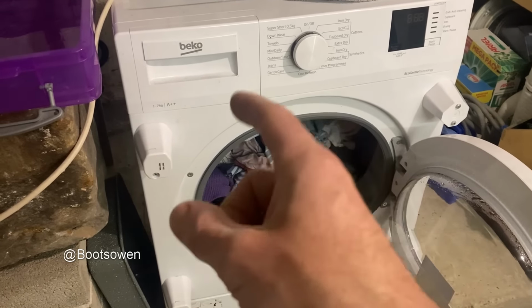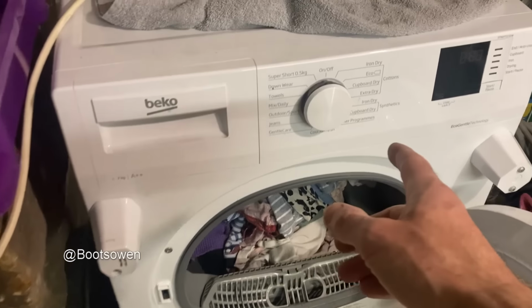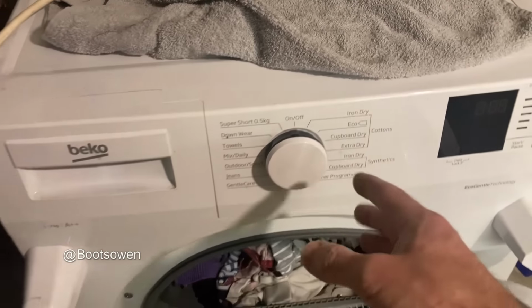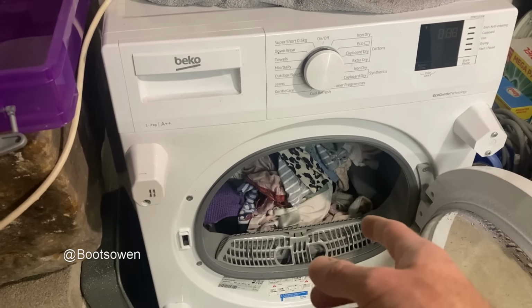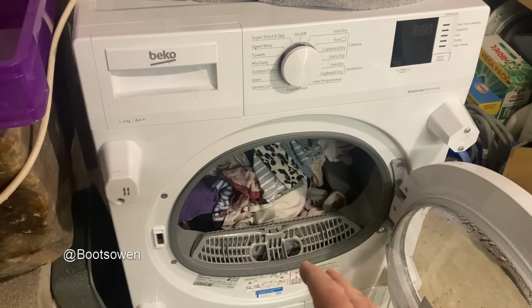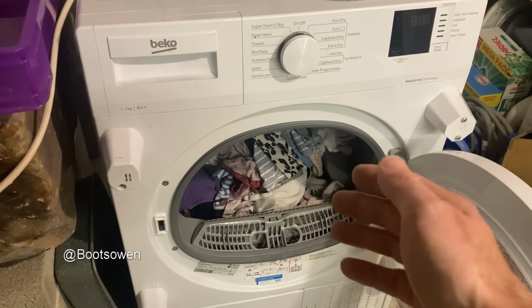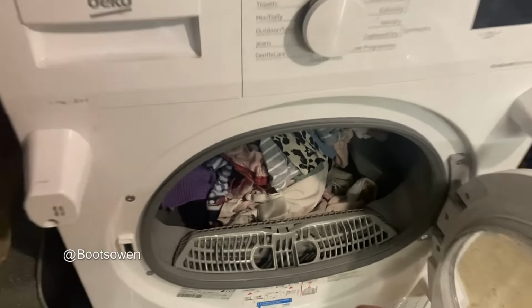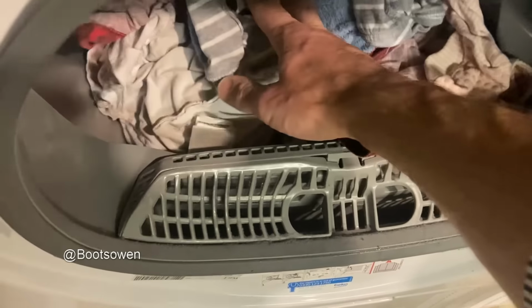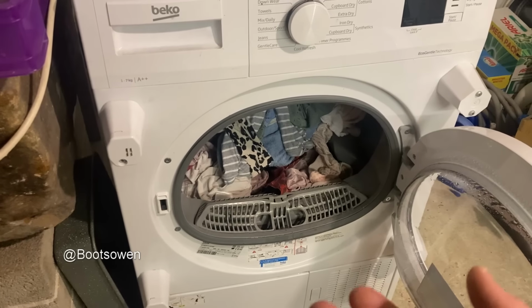So far, I'm pretty sure that pump isn't working, but also I've put it on for 3 hours on extra dry, and it's a kind of self-regulating program, with a load of laundry in it. It did nothing for it. It ran for probably more than 3 hours and didn't get it dry. I put it on for another 3 hours, and I've just aborted that after 3 hours. It's still completely damp. It's drier than it was, but it's like the heat pump isn't pumping.